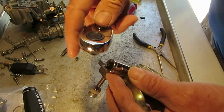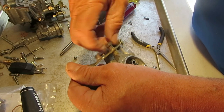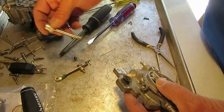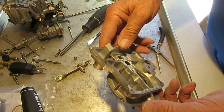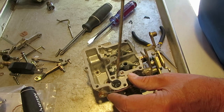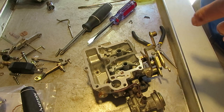Always use sockets if you can. That's one bolt I didn't loosen before I started — most things I loosen ahead of time so I don't have to fool with it. The pump just comes out like that, then this pulls out. Take your boot out — that one just ripped apart; you don't want to soak any rubber. Take the gasket off — it's going to be ready to soak. We're going to soak it in Simple Green for a couple of hours. Be careful: this is aluminum, and if you soak too long it's going to discolor. There's a return spring in here for the accelerator pump, so get that out.